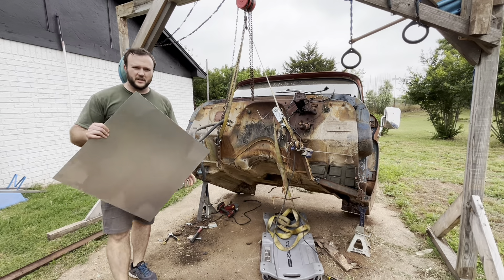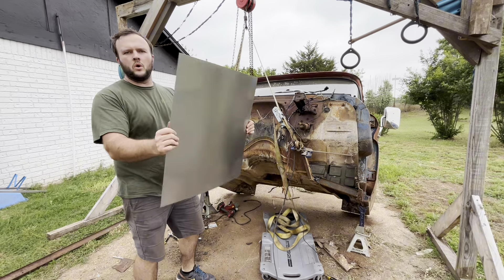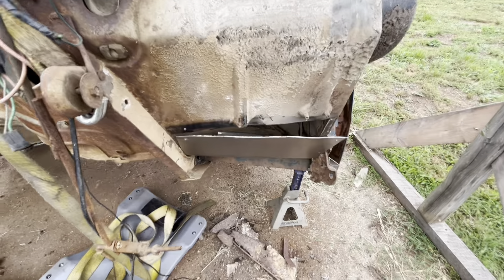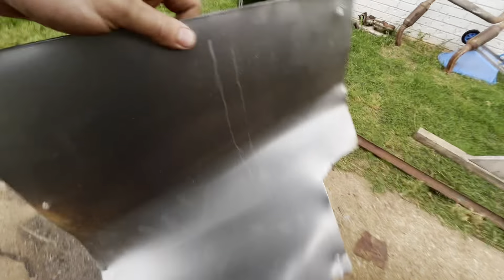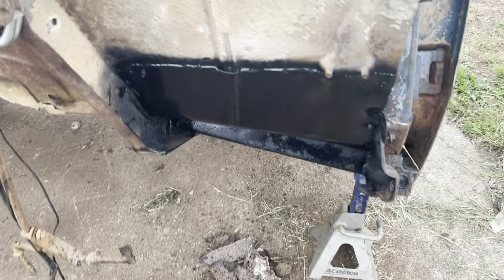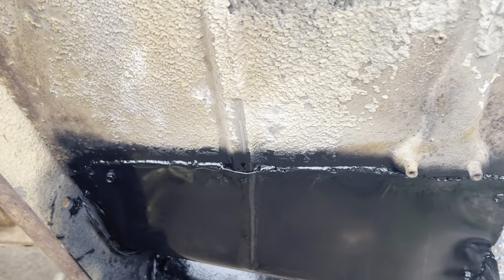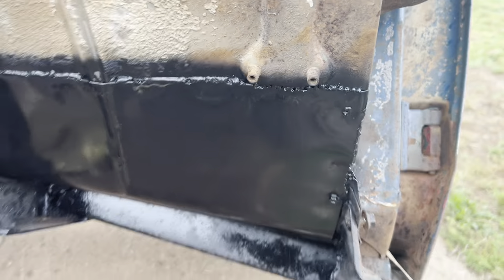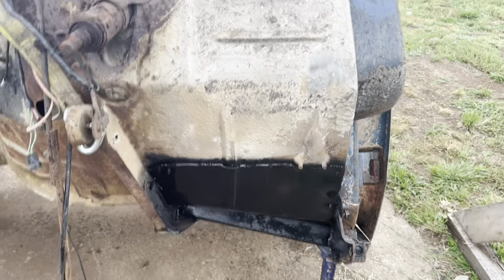The store hooked me up with some metal. You really get a sheet of metal if you need it. That fits terribly - let's use it, but it's a little thin. This is what they had at the hardware store. So let's put some beads in it - you guys want to see how to make beads without a bead roller, check out my video top right corner. Started raining on me so I hurried up and welded it real quick. She's all welded except for around that little spot because it's got a little bit of rust, so I'll attack that from the inside.